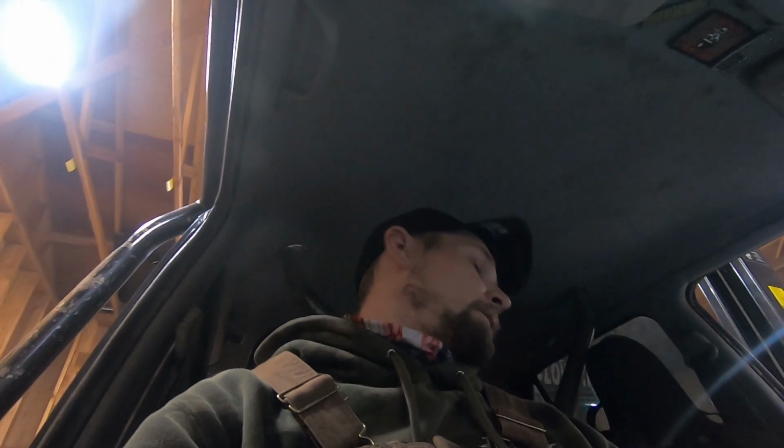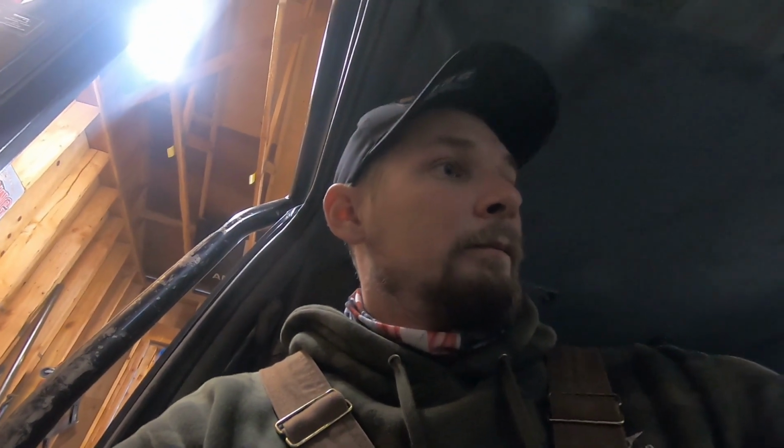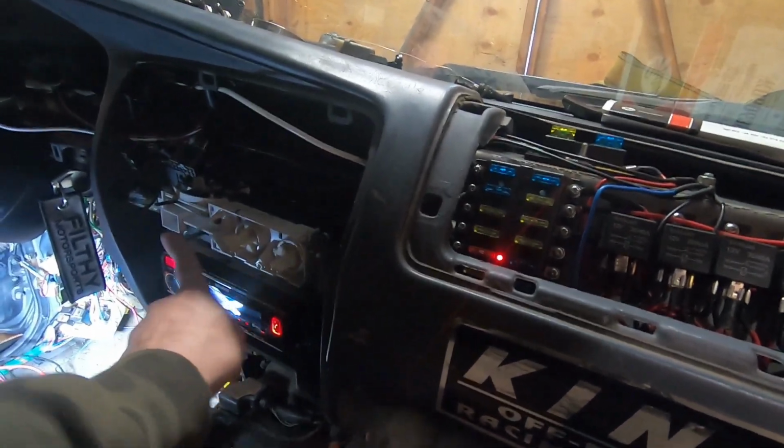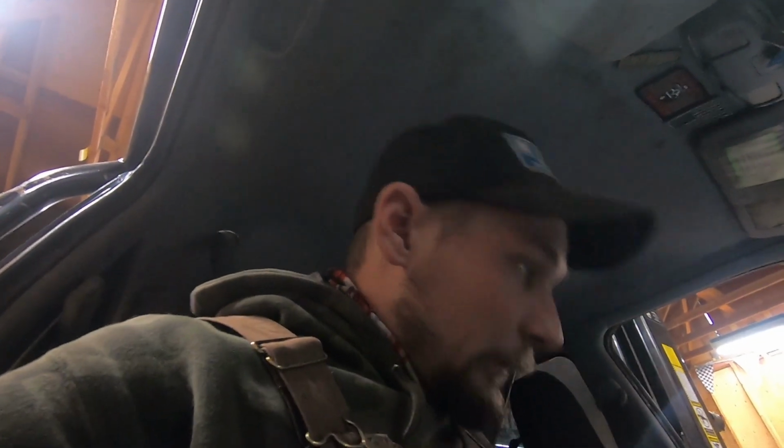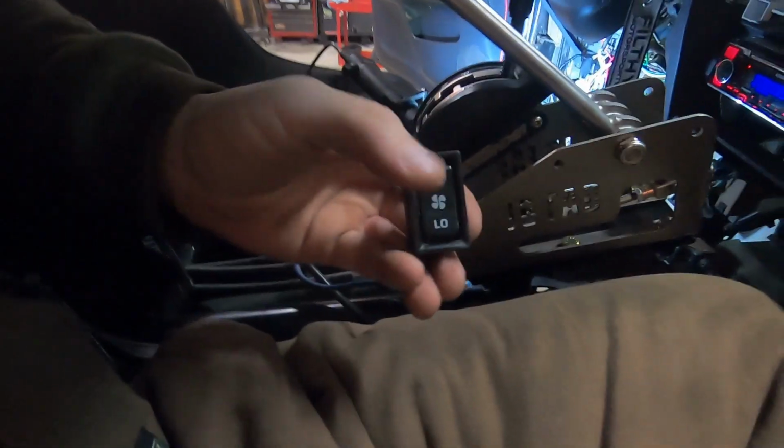So when I took that off, it shouldn't pop it anymore. I don't have a new one in. Or do I? No. So you can see the light come on when I turn it on. So that's cool. Like I said earlier, it's weird how that light's on when it doesn't have a ground yet. It was grounded through the 5th pin. So pull that out and I'll put in another one and we should have heater working. The rear seat heater shouldn't be working yet because it doesn't have power either, but I have the control right here.